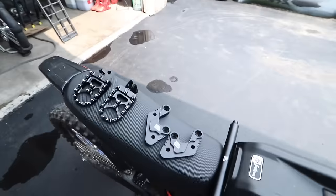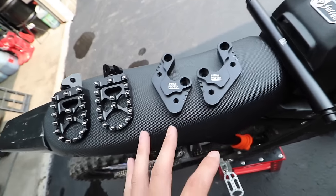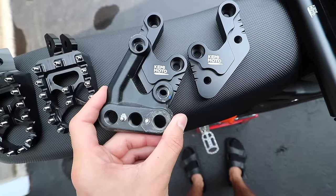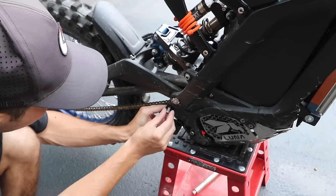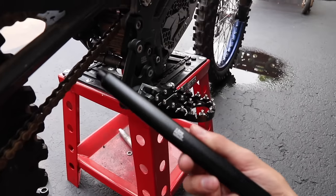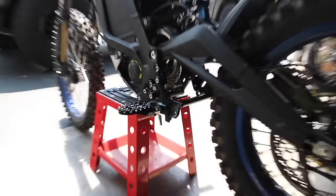Before you see the top speed of the cart, I want to thank the sponsor of this video — Kemi Moto, which hooked me up with some parts for my Surron: the pegs, the dropper peg mount, and the brace in between. These three things are crucial if you have a Surron. You can mount it onto their mount and it drops the foot peg down for taller riders like myself. The process is really easy: take off the two bolts, take off the peg mount, take the new Kemi Moto peg dropper — it's the same hardware — bolt it back up, then take your stock mount, mount it to the Kemi Moto mount, slide the peg in, flip the pin and you're good to go. You need to have the foot peg brace, otherwise you could have flex and the bracket could potentially snap. Once you put the brace in place, it eliminates that flex.